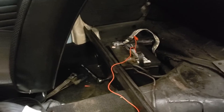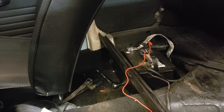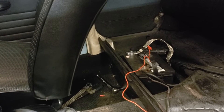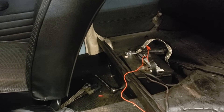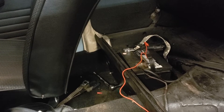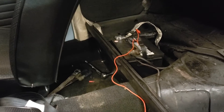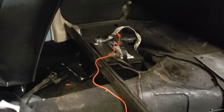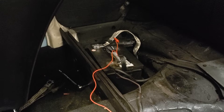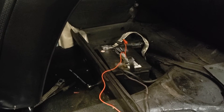Next I disconnected the battery and tested it to make sure I had good voltage. Mine tested good but was only at 60% health — I credit that to a lot of testing being done and the engine being run for a while with no charging. It is a brand new battery, but it's just testing weak because of that. We do know it's a good battery. The next thing I did was check all my grounds to make sure those were in good shape, and that's where I found my issue.